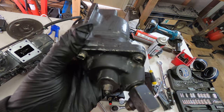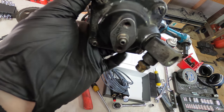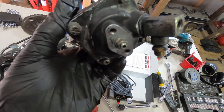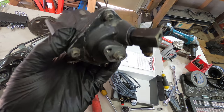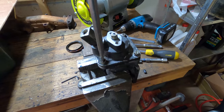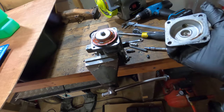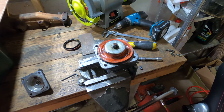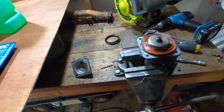Right, so that's the AFC kind of sort of cleaned up. You can kind of see inside there what's going on with the foot. I'm going to take this all apart. There's a diaphragm under this cap here. That there, next to my pinky, is basically the pre-boost fuel screw. Supposed to be a cap on that, so someone's clearly been monkeying with it. That's okay. I might just end up even replacing this diaphragm because it's pretty bad looking.